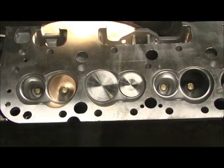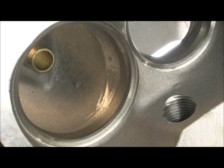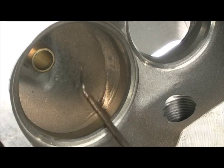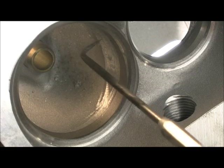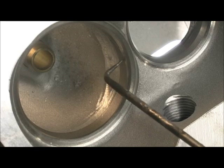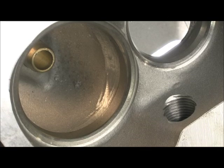I'm going to set up the camera a little bit different so you can see it better. I don't know if this camera is going to let me show you how horrific this is, but it's pretty bad, guys. This is a hook scribe — I'll use this right here to poke holes in ports if it's too thin, to see if I've gone too far. Now watch as I let it slide — boom, catches it. See that? It stops right there, and then it blends back. It does this in different spots all over the head. And the crap bowl job — if they just left the bowls alone and didn't go in there and do it, it would fix half the problem.